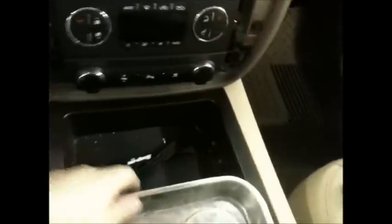And remember how this is a Bose system, like on the black one that we did with the Bose GMC sound system that was in it. Remember, the wiring is down here for the Bose amplifier. We're going to remove the amplifier, so we're going to run the speaker wires direct from our amplifier, our Rubicon Soundstream. We're going to tap the wires down here for the front speakers and their tweeters, and then the rear speakers, and then we're going to do the subwoofer. But let's go and get this programmed, all the steering wheel control functions, all that awesome stuff. Okay, guys, let's get to it.